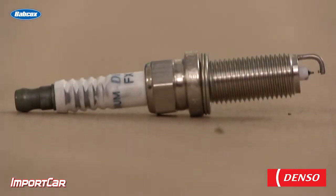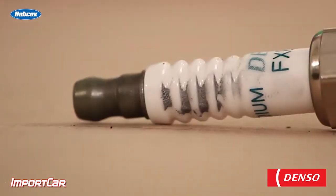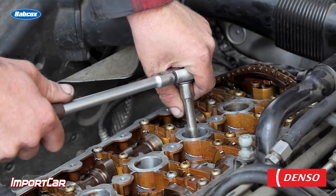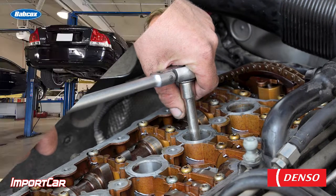This could be through some of that oil, dirt, debris, and grime that you've deposited on that insulator. So what can you do about it? Clean out your spark plug socket and make sure that that insulator material stays perfectly pristine on the plug until you put the coil on top of it.